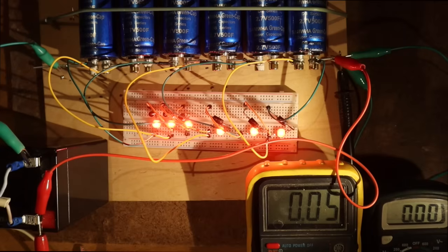So it seems indeed that every time it is charging, it goes better, because every charge is a possibility to have an input current to the capacitors, and input current means that these LEDs are used for their equalization work. While once it is in equilibrium with the battery, the current from the battery is like here. It's 40 milliampere, it's very little. And then nothing can be done about equalization, because if there's no current, there will also be no equalization. But from the other side, if we now charge again, so we put the alternator to work, and it's now on 14 volt, that means there will go current to the battery and also the capacitor.